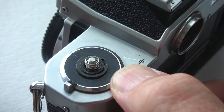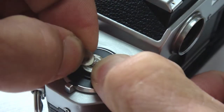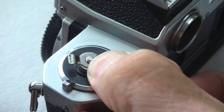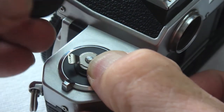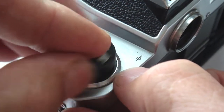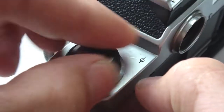and then the rewind knob parts can be laid in place: spring, a washer, and finally the rewind crank washer lever spring plate, or whatever you want to call it, but whatever you call it, it's positioned as shown. And obviously, finally thread on the rewind knob itself.